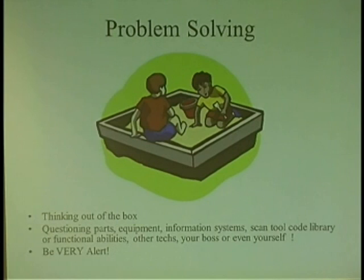So he got a code for Bank 1, Sensor 1, but he's like, it's a green wire. And if you look at the diagram, which is supposed to be factory, it showed a white wire for Bank 1, Sensor 1. So I'm like, dude, I think maybe these are backwards. Someone crossed the wires. He goes, no, I followed all the way up and I did something else. It was interesting. He unplugged the other one and got a code for Bank 2 sensor. So if you're not sure, you can always create a code on the other one and see what code it creates. So he knew that was Bank 1. He goes, no, all that is wrong. I know it's wrong with this car.